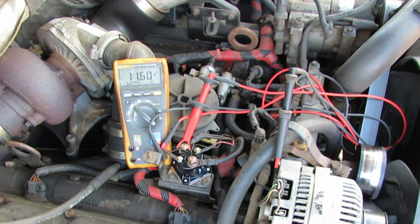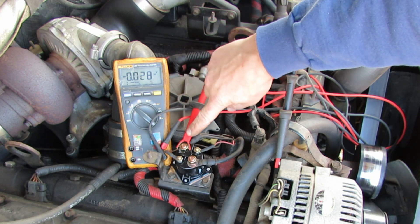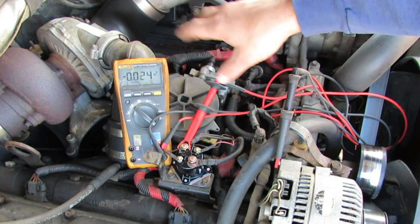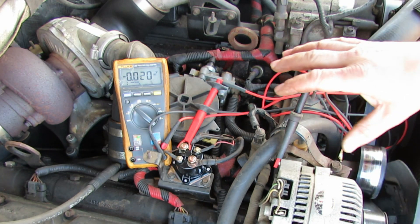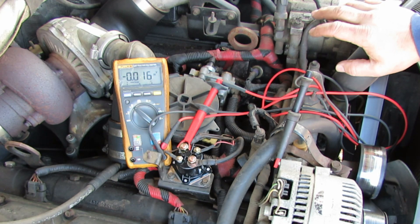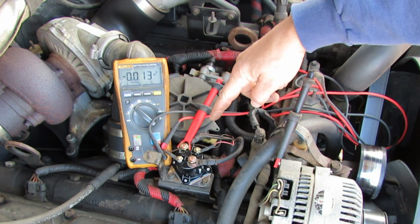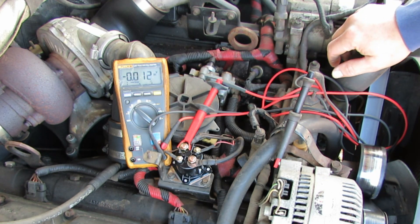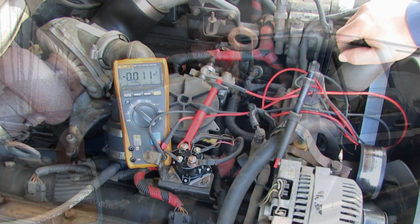I'm going to let those glow plugs sit there until they turn themselves off. They just dropped out, and the voltage on the other side of the glow plug relay is off now - that is a complete cycle of the glow plugs from cold. The time that the glow plugs stay on is dependent upon coolant temperature and oil temperature. You can see the wait-to-start light doesn't actually indicate whether the glow plugs are on or off, since it only comes on for about 10 seconds before you start. The relay is working fine and I should not have any issues. Well, there you go, we got Babe back up and running - it was not a hard job at all. Thanks for watching and we'll see you next time.